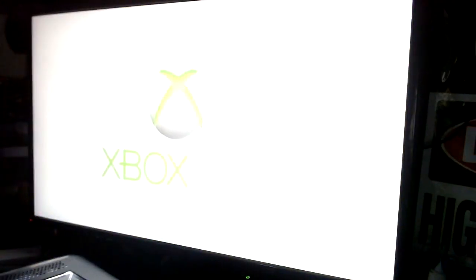Okay. Now, before you do anything, remember I mentioned Aurora CrashPatcher, okay? What we have to do is shut down the console. Just shut it down, okay? And then we're going to restart the console, all right? That way it loads Aurora CrashPatcher as well, because we have to have that loaded. Just putting it in dash launch doesn't make it load. It just means that on the next boot it's going to use it, okay?